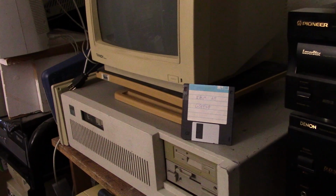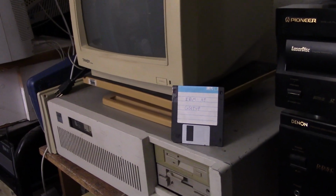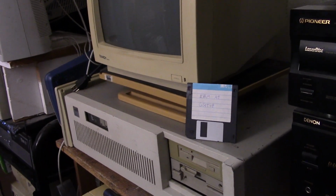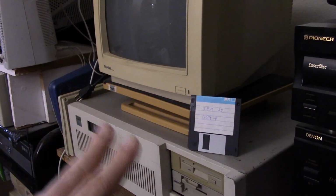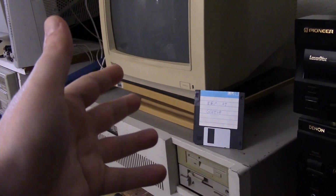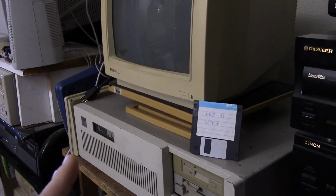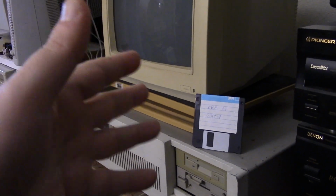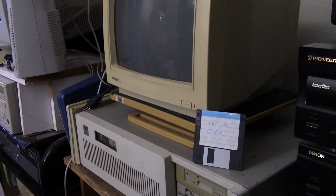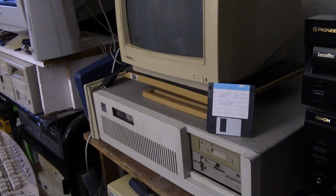So about setup, I'll talk about that real quick. As we know, most PCs require some kind of initial setup, or a re-setup if, say, the CMOS battery dies. Usually this is just designating what type of floppy drive and hard drive are in, and that's enough to get you in and running. But IBM, at least in my experience, has always been really big on setup programs. Even in my late 90s IBM PL300 PC series, if you change anything, it throws an error on boot and wants you to verify it in the BIOS. You change memory, change the video card, add a mouse, and you'll usually get some kind of setup error and it will want you to go into setup and verify the change. It's kind of annoying. I see why they might have done that, but I don't know.